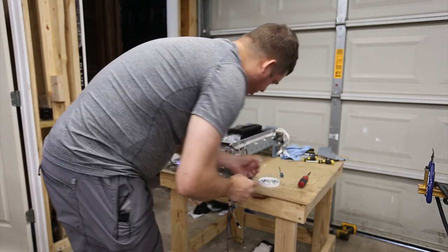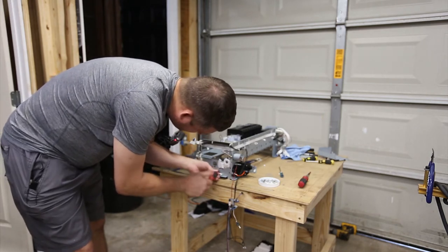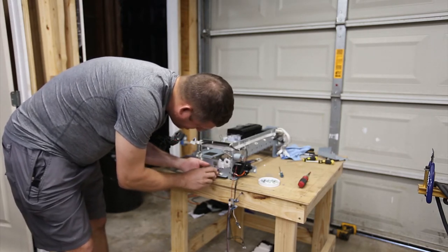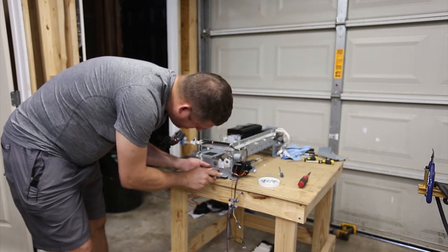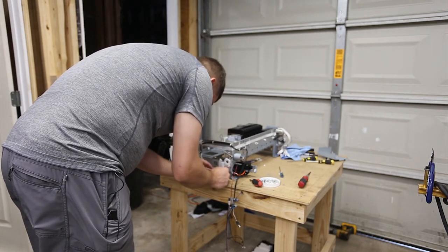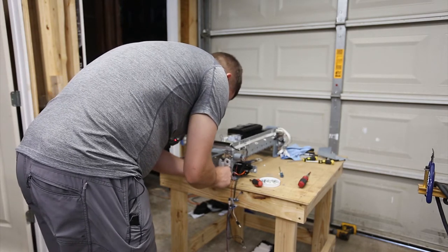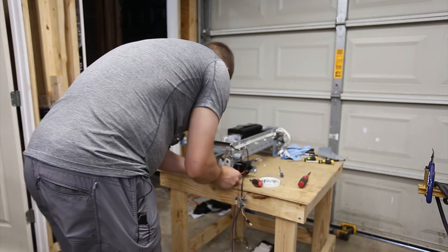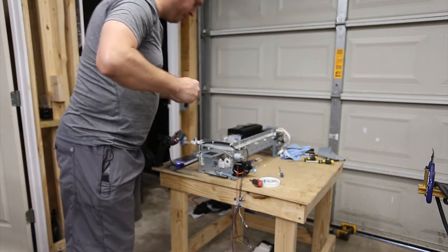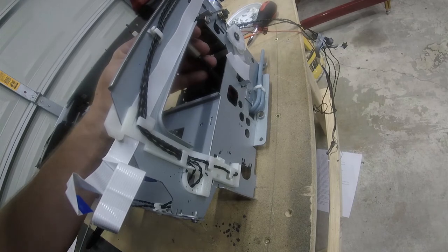So what this little device does is hold the capping station — it's actually a critical little piece of metal. It has some little dots that just keep it where we want it. We'll go ahead and route these tubes where we want them, just out of the way. They feel like silicone — no way Epson's ever going to tell us. Then we use a long screwdriver to get down on the capping station; it should just be another fine thread screw. Everything that screws into metal appears to be fine thread.